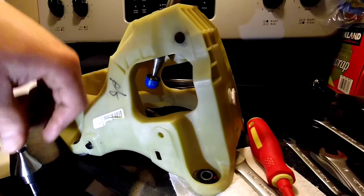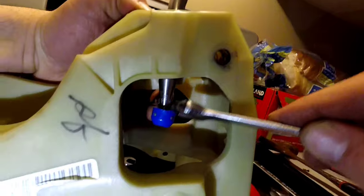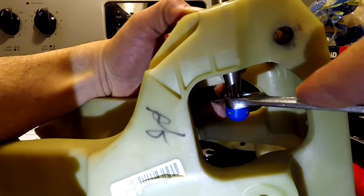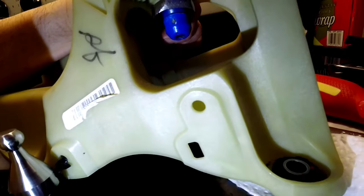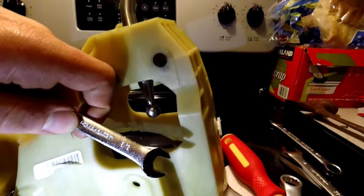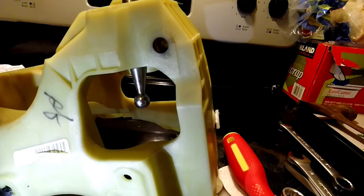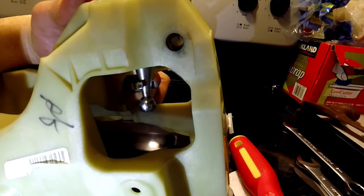The 8 mil can't seem to fit, so I'm going to try a little bit bigger than the 8 mil just to slide it up the collar a little more. You see that — they want to use a 13, you cannot fit anything in there. So I'm using a 3/8. Wow, okay — that wasn't as hard as I thought. Once I figured it out, it was a 3/8 and a 13. There's no way an 8 is going to work, no way a 12 is going to work, no way a flathead is going to work. So 3/8 and 13 mil — came off on almost my first attempt.